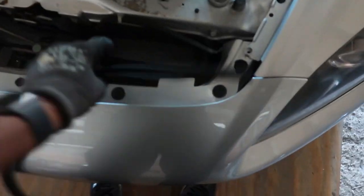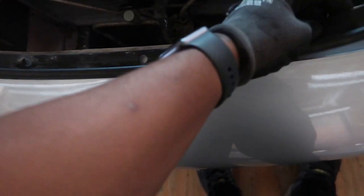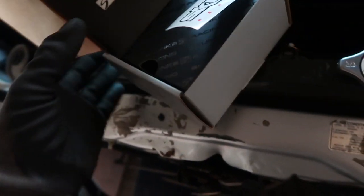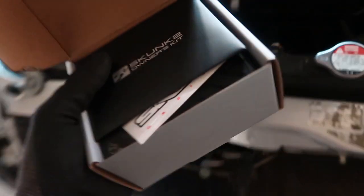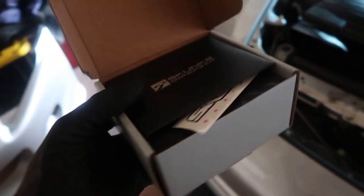Back home from the junkyard. I finally have the little rubber seal I need for the hood, so when the hood closes it presses against this and doesn't have that weird gap anymore. I also went to a speed shop in the area to pick up an oil drain plug bolt because the one I bought from AutoZone seems like it's still leaking a little oil. I went and got a better one — a Skunk2 drain plug that actually collects metal from the oil.